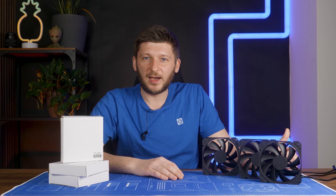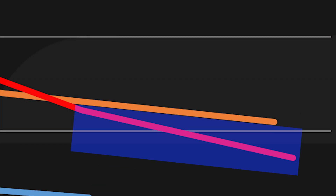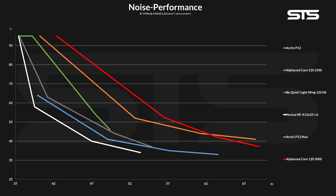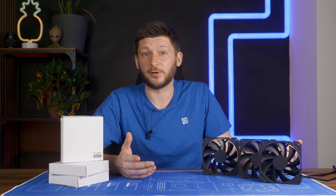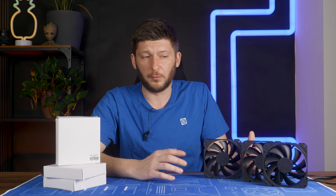But what about the noise? Well, as I said, 49.9 dB, and our dB meter definitely picked that up. The graph for the 3000 RPM takes plus or minus the same path as the 2500 RPM version, but because of measuring point differences and the fact of dual ball bearing — margin of error and stuff — the whole thing is slightly off-shifted, and unfortunately it's not shifted in the good direction. Except for the first 10% of their respective max RPM settings, the slower spinning Core 2500 RPM was always just a bit ahead of the quicker one. But at least you are better off at full blast for both temperature and noise-to-performance. Though don't forget that noise is not a linear thing — the further you go to the right side of the graph, the more impact it has.